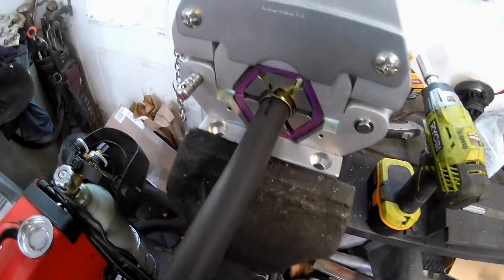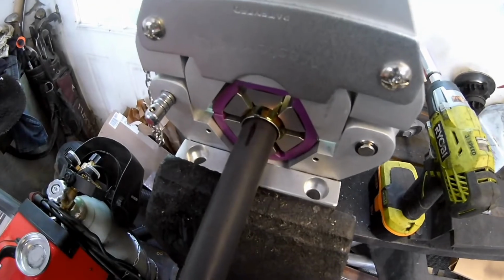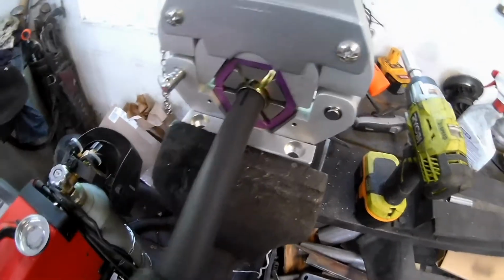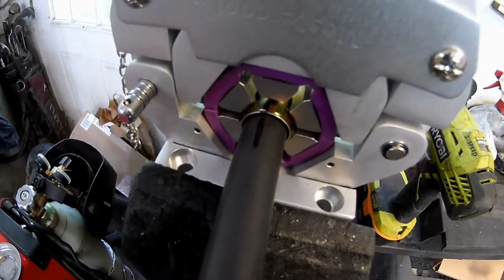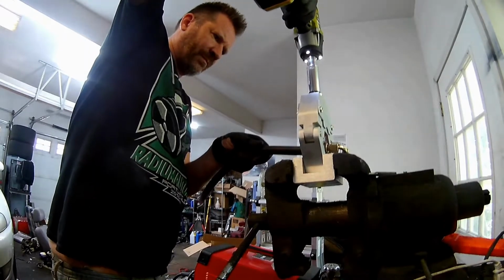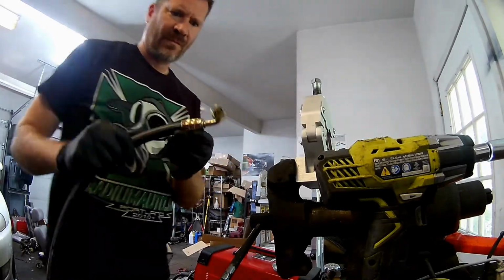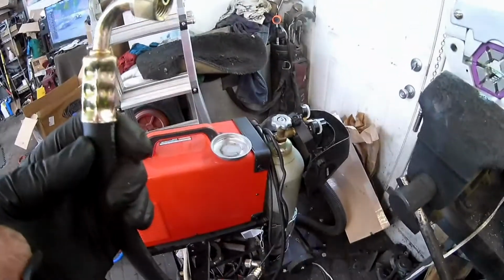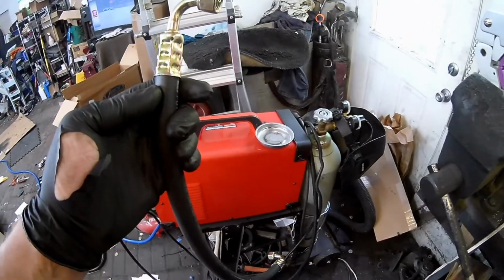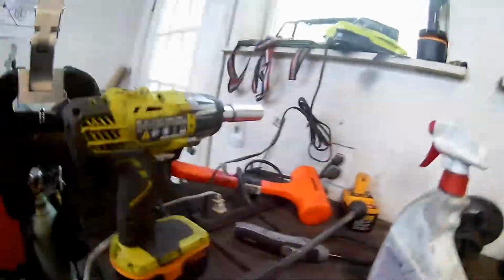I'm actually going to get an O-ring, and I'm gonna tighten that one down so that I can get everything together, and that's going to be it for radiator and all that to be in its final position. So you can see where my mark is, and now we'll just clamp it down again. And there you go, another AC. So you can see how this is pointing one way and this is another way. I know I've said this, I'll say it again. You need to make sure those are oriented correctly because they're not going to twist much.